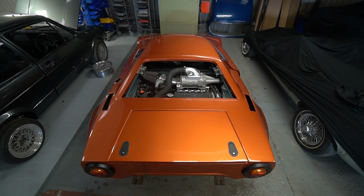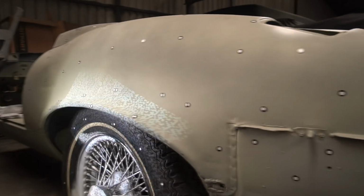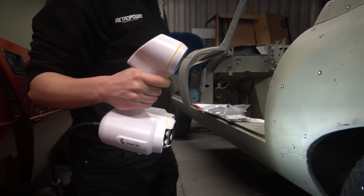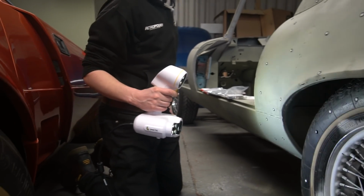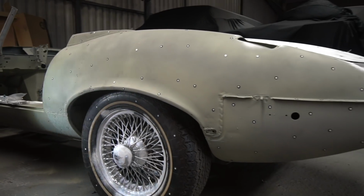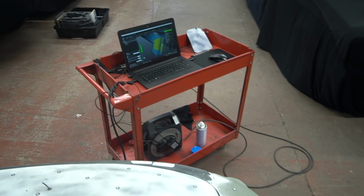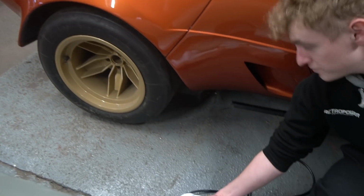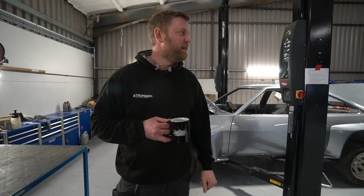And then on the E-Type, which is just the other side of the Stratos, more 3D scanning. We're planning a lot of the component design on that car to be done in CAD from the 3D scan data. Almost all the interior components will be designed in CAD virtually inside the 3D model, and then prototyped in 3D print, trialled in the car, and then usually either CNC routed in MDF or machined in aluminium, or some parts might actually be 3D printed in their final guise if they're going to be upholstered, for instance.